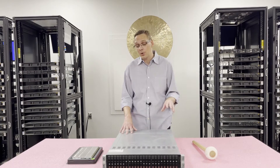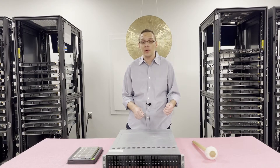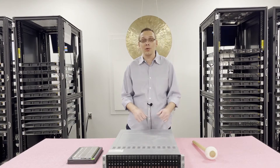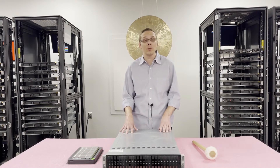We're going to open it up. I want to show you how to pull the blades out, how to install the RAM, and pay attention to all the channels. But before we do, I'm going to grab my ESD gear. You really never want to be inside your machine without some sort of protection.